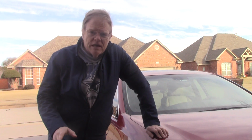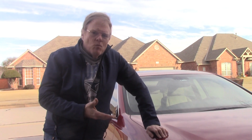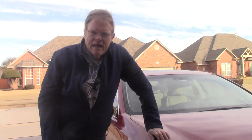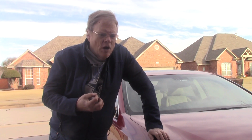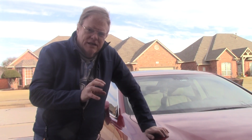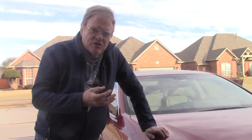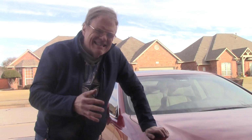So there are a couple of different ways that people have approached doing these kinds of DIY tire rotations. One of them involves jacking up one side of the car and then doing a swap, and then rolling over to the other side, jacking up that side and doing the swap. That's okay, except for the fact that the jack points around that area are typically just individual reinforcements, and I'll show you here in just a minute. Those are reinforcements intended for the little scissor jack, the temporary emergency scissor jack that comes with most vehicles. And if that's bent or misaligned, then it might be a problem. Also, I don't know that they were really intended to lift both the front and the back ends of the car at the same time.